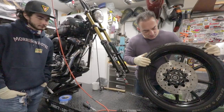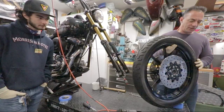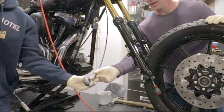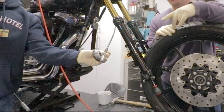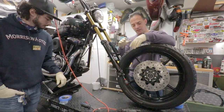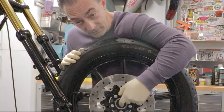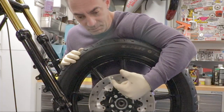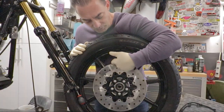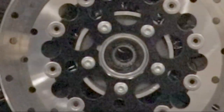Here's what we did with the front wheel — we've got both discs on now, originally we just had one. On the older bikes you have a speedo drive on the front wheel; that's how the FXR runs. Newer bikes run the speedo drive off the transmission with a sensor. This front disc is for 2000-and-up bikes with no speedo drive — they ran spacers and sealed bearings. We're running the Timken bearing and the older style nine-spoke front mag, so we had to accommodate the speedo drive by cutting out a little notch right there.